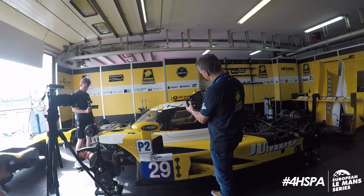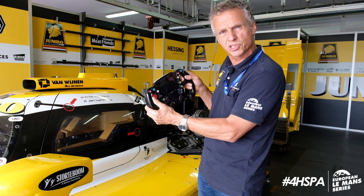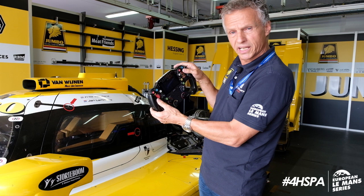On the right top, that is the pit limiter. As soon as I come into the pit I press this button and it limits my speed to 60 kilometers per hour, so I can't over-speed. If I press it too late, I have to go up in the tower and explain why, and probably get a stop-and-go penalty. This one is the kill switch — if we want to stop the engine, obviously we press that one.